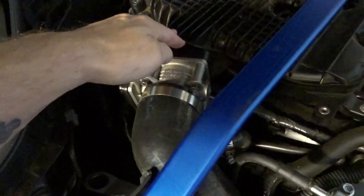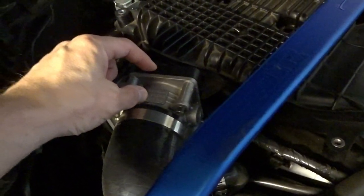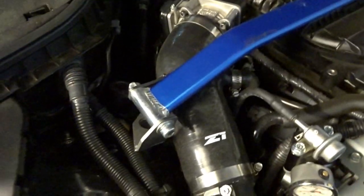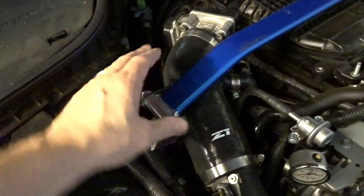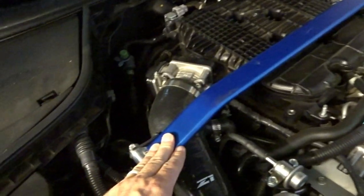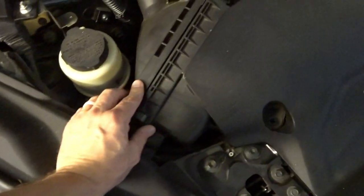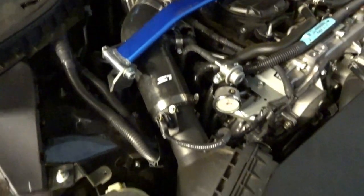Installation should be a breeze — they're not that large. They go in between the throttle body and the plenum or intake manifold mounting point. But you're adding just slightly over one inch of material, which is going to move your whole intake system outward. You can see how close the strut tower brace is to the intake tube now — adding material is obviously going to push hard up against the strut tower brace bracket, making it essentially impossible to run the brace. It's also going to push your intake tubes, potentially messing up mounting points if you're using a factory airbox, may require trimming silicone intake tubes, and may make cold air intake systems more difficult to run.